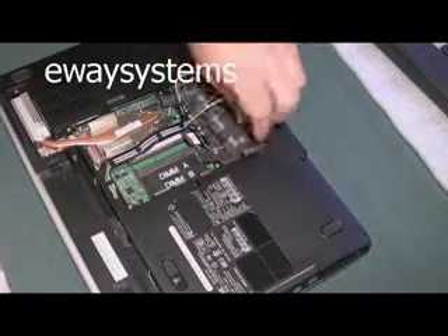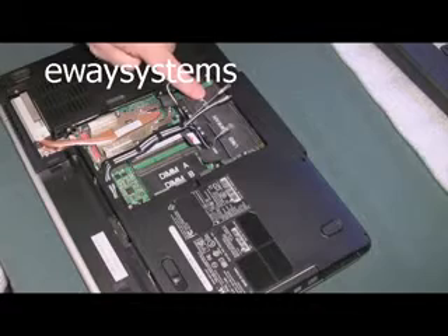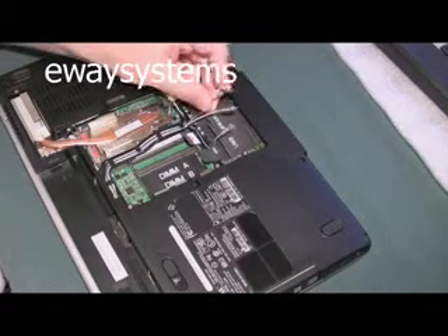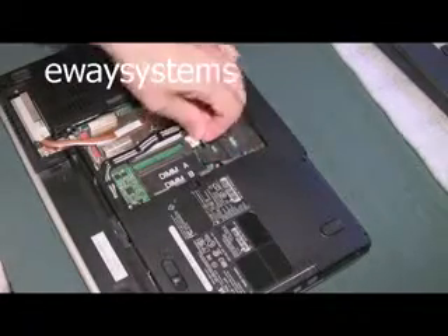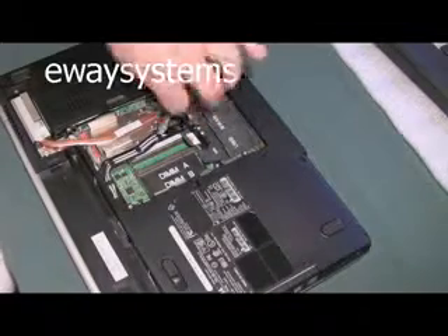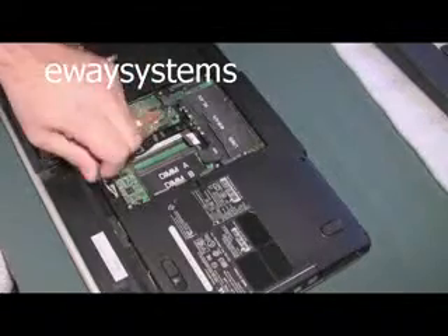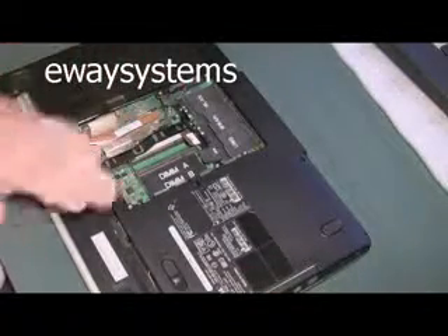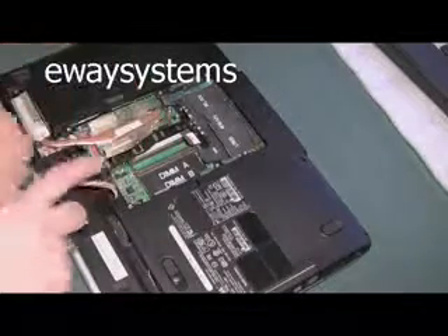Let's loosen up these wires — we're going to have to get these wires out of the picture. This is for WLAN, this is for WWAN which is like a mobile broadband card, and this is your Bluetooth — the blue wire. It's nice they usually make the Bluetooth wires blue, just so you know. We're going to have to get these out of the way because when we go to pull the screen off, these all feed up to the top of the screen because they're antennas. They need to get to the highest point.